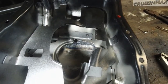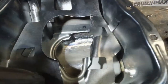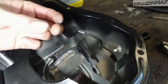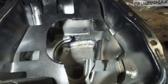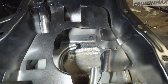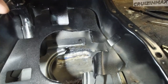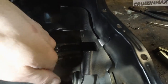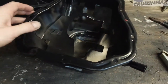This is what it looks like inside — not too bad. There's weld spatter — those little metal balls stuck everywhere. You want to make sure you get rid of every single one, because it can be bad news if it gets into your oil galleries. Clean this up 20 times, or 30 if you have to. I'm going to do it again several times, but now it's time for the water test.